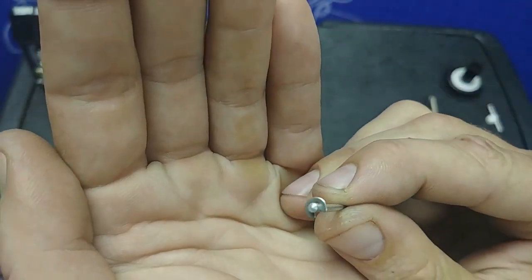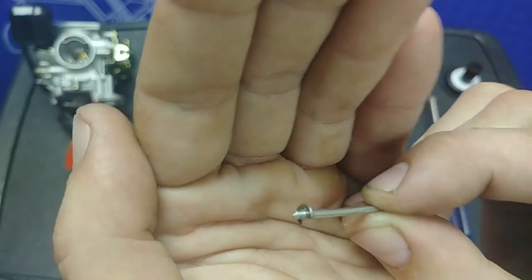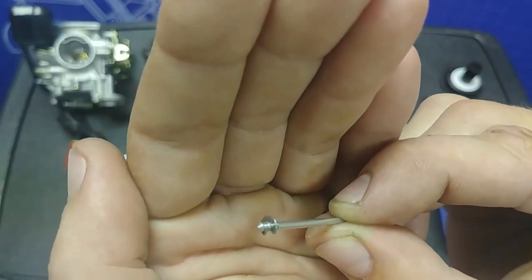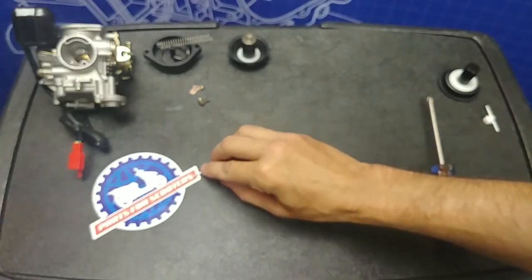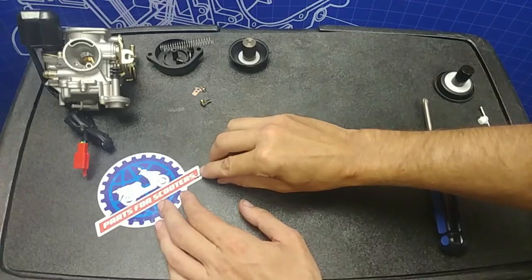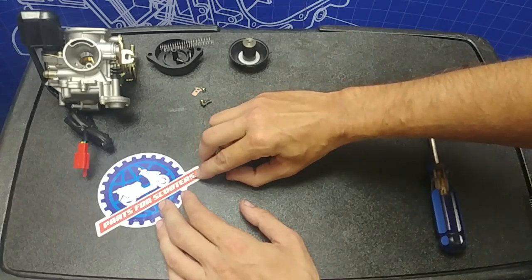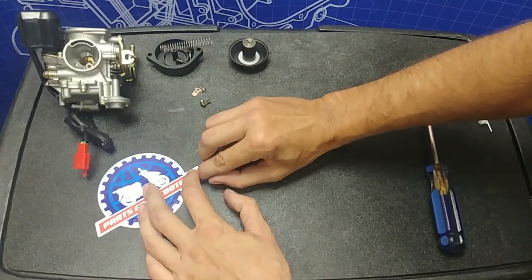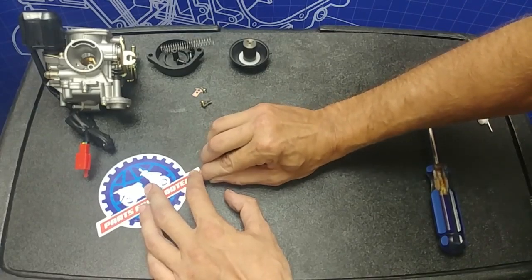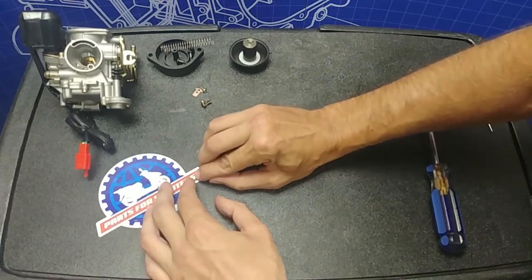Removing the circlip can be a pain since we might not have special pliers small enough to grab it. So here's a trick: with the opening in the circlip, put that opening side down on a hard surface. What we're doing is supporting the clip and pressing the needle out of the clip. Put your finger as close to this clip as possible — not in the middle as you could bend the needle — and cover the clip with your other finger. Now press down. You might feel a click; that's the clip removing from the needle. Press down and wiggle the needle slightly back and forth.